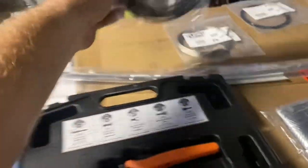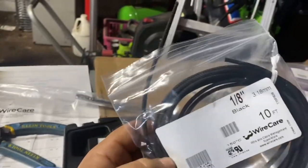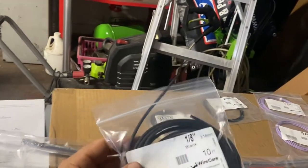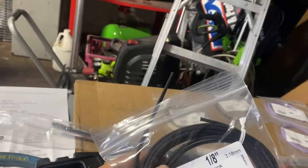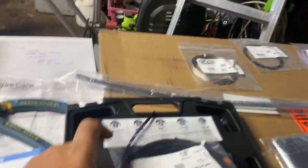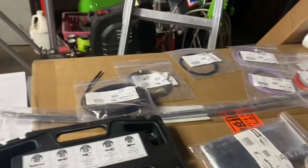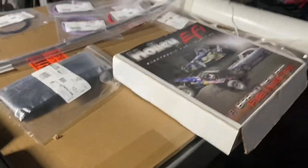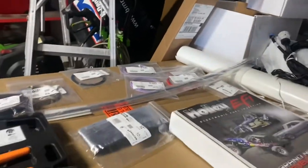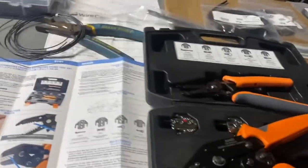This is my shielding — this is going to be the electromagnetic interference shielding, noise shielding: EMI, RFI — so radio frequency shielding — and ESD, which is the static shielding. All the Holley stuff is double shielded; it's got a tin shielding and it's also got a ground shielding. Anyway, back to the crimper.